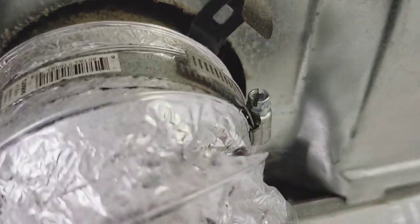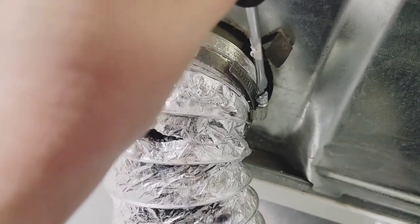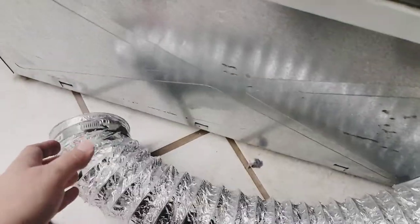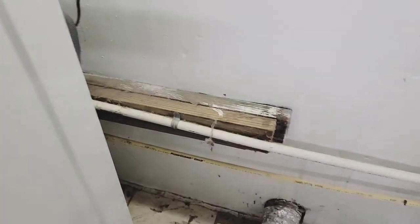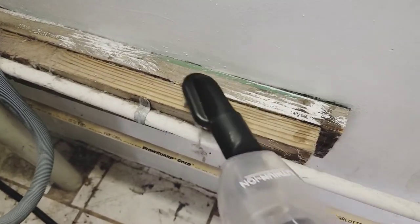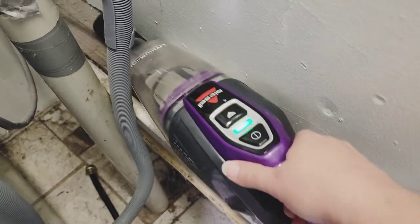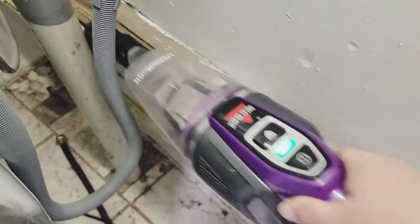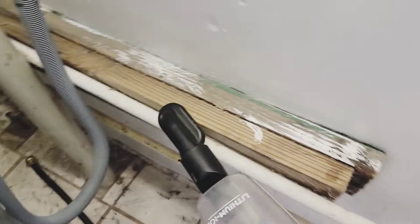So you'll see here, my dryer was not drying as well as I thought it should. I had put it on a bulky load dry time, which normally dries it really well, and it didn't get dry. So I pulled it out. I also checked the filter area to make sure that it wasn't full of junk, and it really didn't look bad. So I pulled it out. You could see that hole was in the little vent thing. You can also see that we had a lot of extra of that coil, so I cut it down a lot when I fixed it. I just took it off, cut it, and put it back on. Made sure it was nice and tight with that little, whatever you call that thing that wraps around it and tightens up.